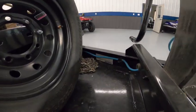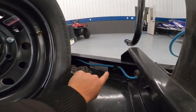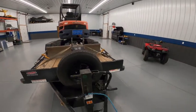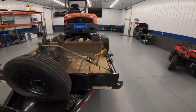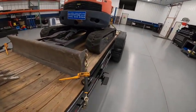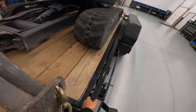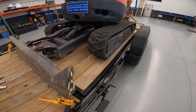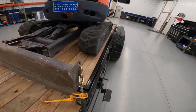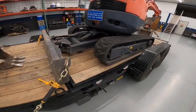Another thing that makes me think it didn't go through a final inspection: the wiring. On these trailers there are retention clips that run along the side of the frame all the way down beside the tilting portion — it's an easy and safe way to store the wire out of the way. But when I first tilted it, the wiring wasn't even in those retention clips; it was just hanging there in harm's way where it could definitely get pinched.